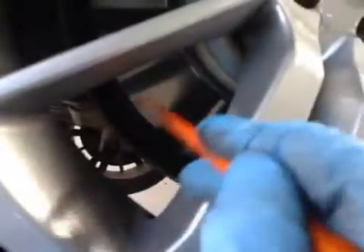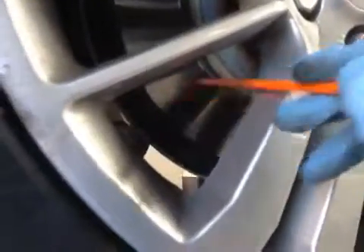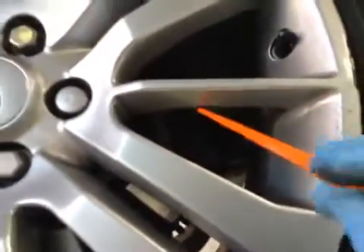The front discs are lipped, so these are recommended to be replaced. The front brake pads are on 10 millimetres, so the pads are good — but if you change the discs you will need to replace your pads at the same time. So the pads are in green, discs are in amber, tires are in amber on the health check.